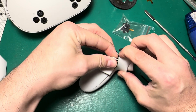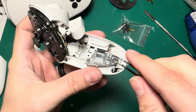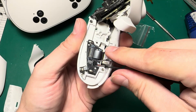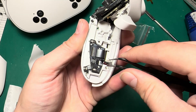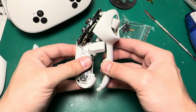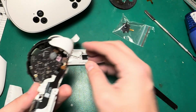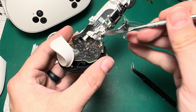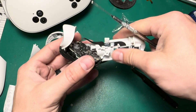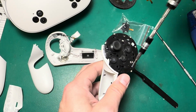Pull straight back and out it comes. Unlike the Quest 2 controller, I do need to unplug the haptic feedback motor here — just grab tweezers and gently pull. Then this front grip portion just comes off, and I'll pull the Bluetooth antenna off all in one go. Next is the battery compartment — I'll use my pry tool to flip that latch. Now that the battery compartment is almost ready to go, I'll finally take out that last screw.